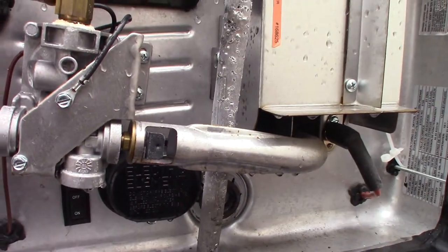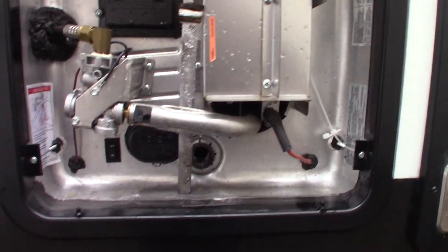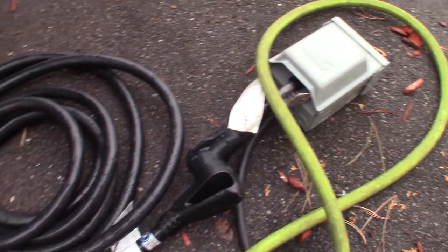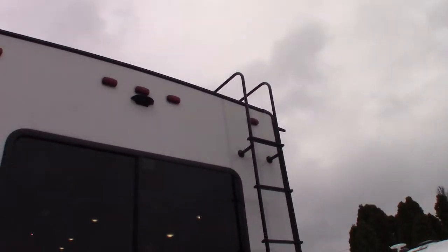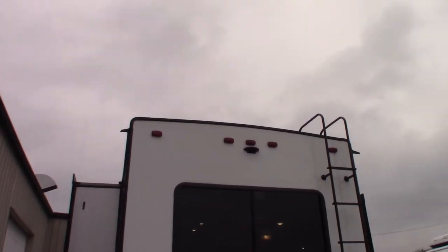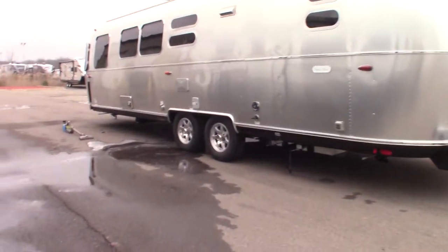The same goes for the gas. This is your anode rod slash drain plug — it goes right in here, that's where you drain the tank. It takes a 1 and 1/16-inch socket with maybe a six-inch extension so you can get your ratchet on and swing it. This is a 50-amp system, so you've got a 50-amp cord — it comes with all the reducers so you can reduce it all the way down to 20 amp if needed. There's a ladder, and the manufacturer states you should inspect the roof every 90 days — check for cracking or separation in the sealant, roofing material, and vent covers. This housing tells us we're pre-wired for a backup camera.